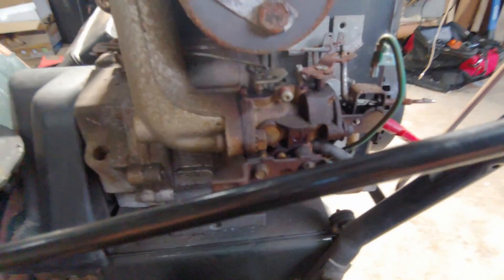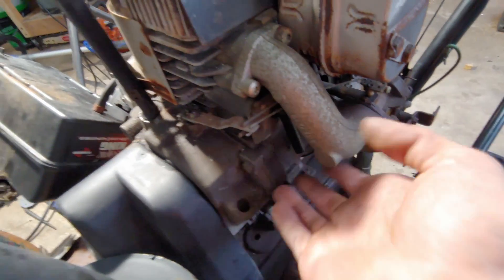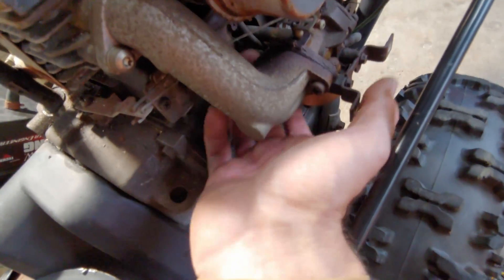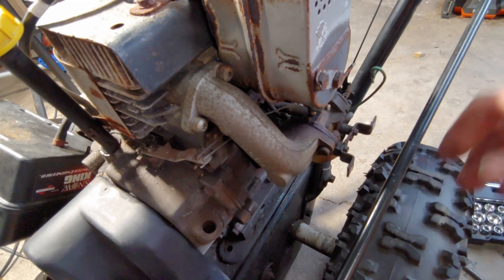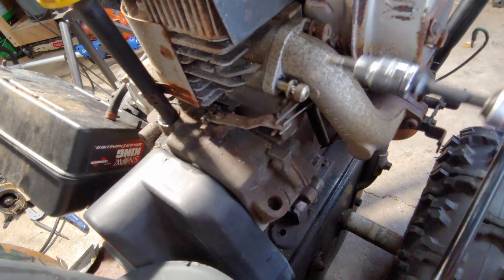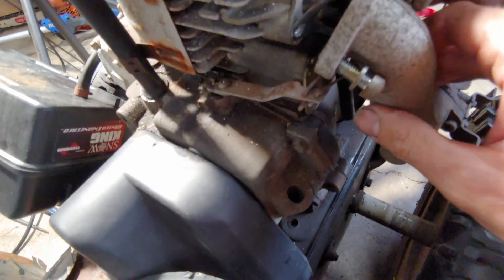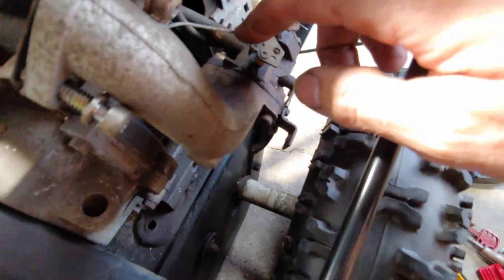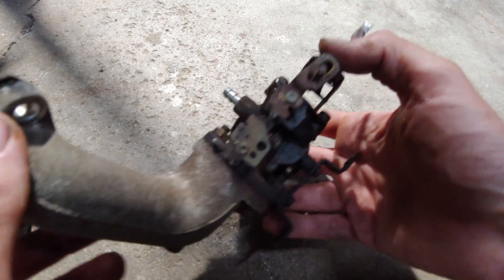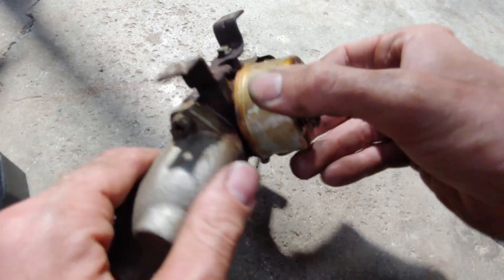Trying to remove these is a little tough. I'm actually going to take the whole tube off here with these torques so I can get better access, because I can barely even get a wrench on this one and this one's impossible where the angle is. So I'm just going to take this whole thing off - it'll be a little easier that way. I can reuse this gasket, I don't feel like buying a new one. Got it off with a little noodling. The worm clamp that was on the fuel line just completely disintegrated. The gasket got a little torn so I'm not sure if I can reuse it, but got it off so I'm going to take the float bowl off.